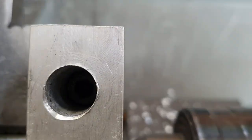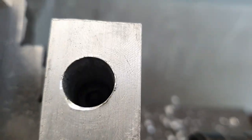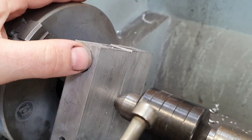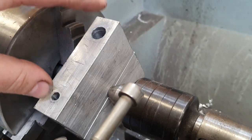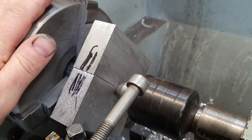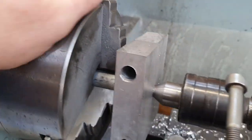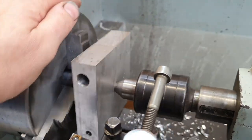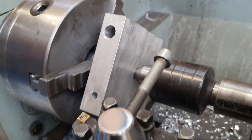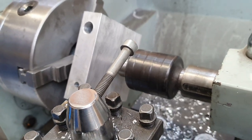Two rectangles stuck together — bolts in from each side but placed on the same side to avoid balance issues — you don't want a shaky drive shaft. Turning between centers, I've made a thing to hold it. The fun starts — this bit's going to be scary.